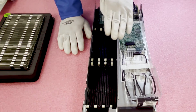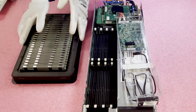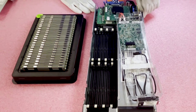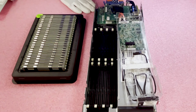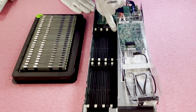Now I'm going to show you how to physically load the modules — we're actually going to max this whole thing out. We have some 32GB load-reduced 1866MHz modules here, which is the top spec for this machine, and we're selling several of these to one of our customers right now. One thing I like to do is pop all the tabs open in advance so I'm not fumbling around when I have a module in hand.